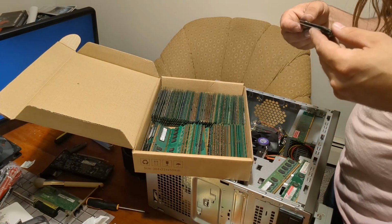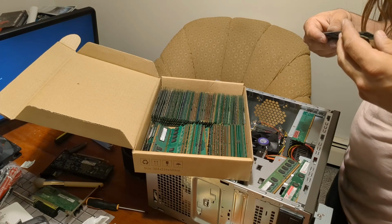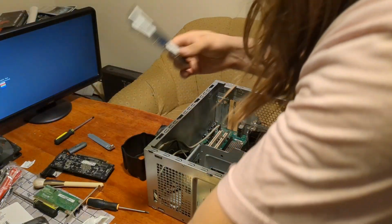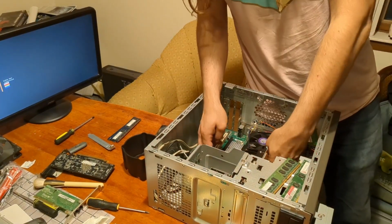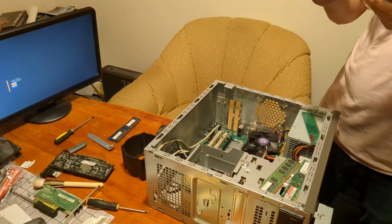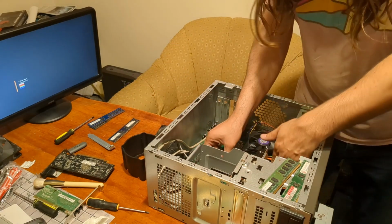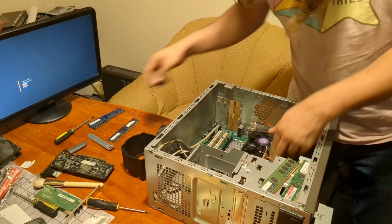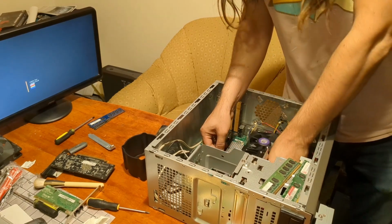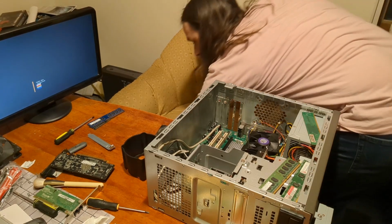Okay. These are 5300U, so they're slower. 12E1 timing is the same. They're both 2 rank by 8. That actually might be our issue. It might be the ranking. Intel is notoriously picky about rank. These are 1 rank by 8. Well, let's see. That's one thing you won't really find when you're looking up the RAM compatibility. Oftentimes they won't actually tell you what rank it supports. So, yeah. Let's see.